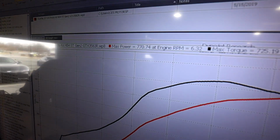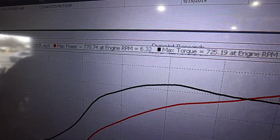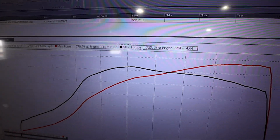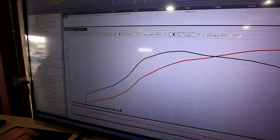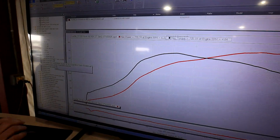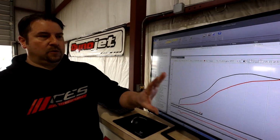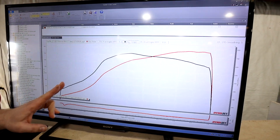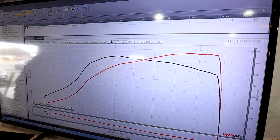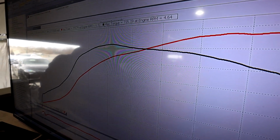One of the biggest differences was the exhaust housing. We upgraded that to a slightly newer design. It is the divided twin scroll housing that we use on the Garrett Gen 2 turbos. And the car that we were showing you over there, the space gray car, we have some dyno data from that as well. And one thing to note is this one was a full build, full kit. It had our dual low pressure fuel pump upgrade setup on it. So it had dual 450s, the Walbro pumps, and it also had the EO Speed manifold with port injection.